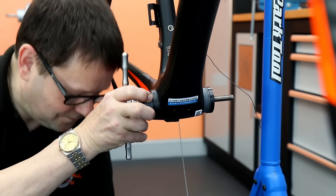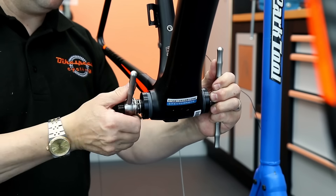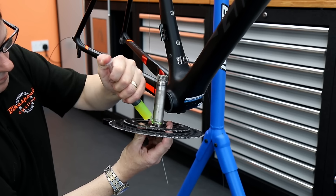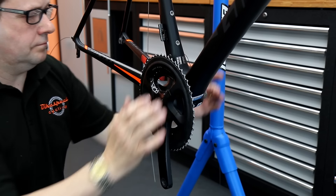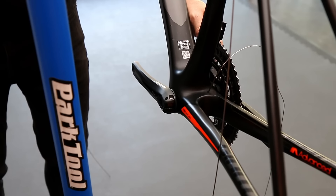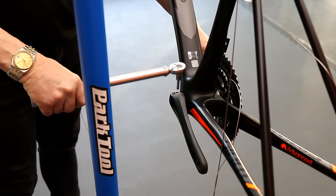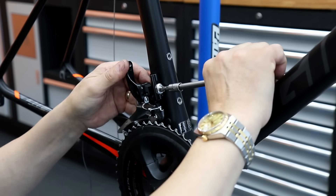Now we're going to press in the bottom bracket. The press I've got sits on the outer edge of the actual cup of the bearing — so it's pressing the cup itself into the frame, not the bearings, which means no chance of damaging those brand new bearings. They go in absolutely spot on. Just a little bit of grease on the chain set to help it through the bearing. On goes the now-safe left hand pedal arm with a little bit of pre-tension on the bearing. Once the bolts are in I'll torque those up before putting the front derailleur on, so that left-right movement is precise.